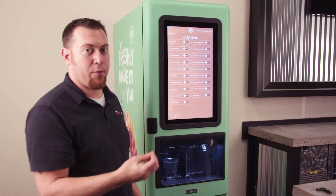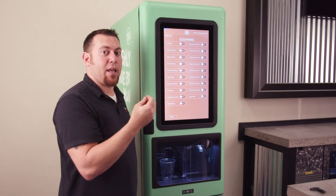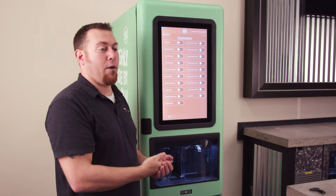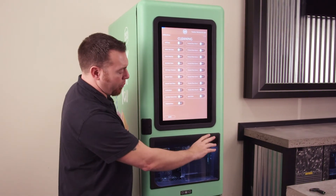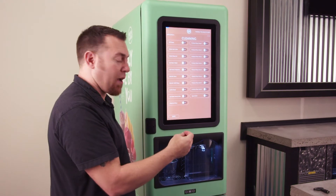What could be happening if you're witnessing water coming out one of these dispense valves is that one of those solenoids may be staying slightly open, or there might be debris in the water line, or it could possibly be a failing solenoid. They stay open and allow water pressure to push through the product line continually and then up through the dispense point. It can start as just a little bit of a drip or a weeping of that valve.